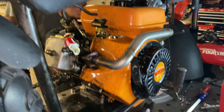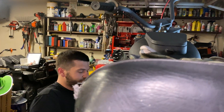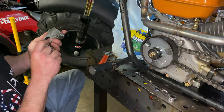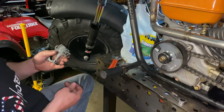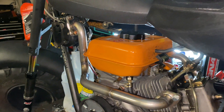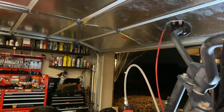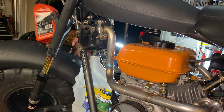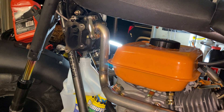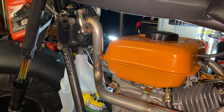How are we going to make this diesel stop rolling so much coal? These plates — some of them didn't fit right and I had to put the ones I actually used on the drill press for a while. It said it would fit the VZ21 and everything but it didn't fit. Look at that coal rolling out the garage — that is because this is an RHB31. It says for RHB31 or VZ, but the RHB is just a higher-end model of the same turbo with the same specs, just tighter tolerances. Do we have any boost leaks anywhere that you can see?